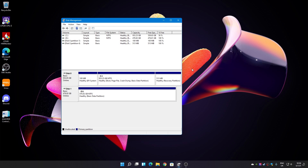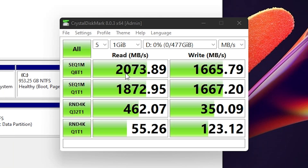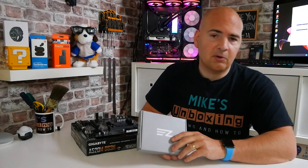I think we need to do a speed test on this drive to see how it works. Just done a quick test in Crystal Disk Mark for this particular drive, and on the Silicon Power specs this drive is capable of 2200 by 1600, or 2200 by 1700. It is exactly where it should be in terms of speed. We haven't had any restrictions at all on the PCI Express bus on this particular drive. Really happy - it's worked as intended and has possibly prevented me getting another motherboard. So the installation is done, we've formatted the drive, and done a quick test to make sure it's performing as it should - and it's performing exactly within specifications.